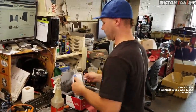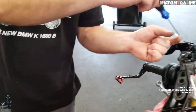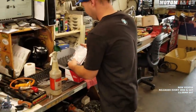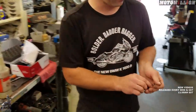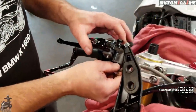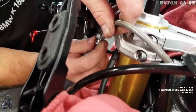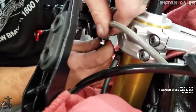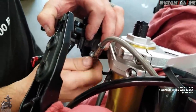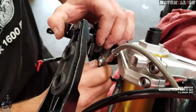The kit also comes with a really precision flathead screwdriver just to adjust the lever. It also comes with a nice little screwdriver for adjustments. You should never have to force the banjo bolt — you should be able to start it and screw it in by hand. It was good before but was bottoming out too early; with the right bolt it snugs up nicely. That looks gorgeous.